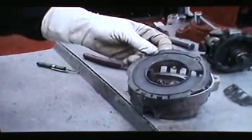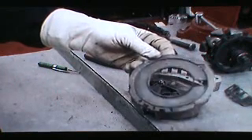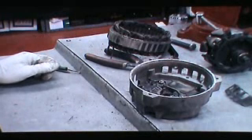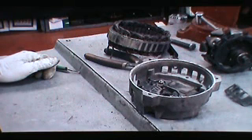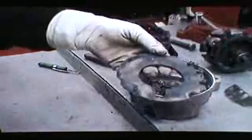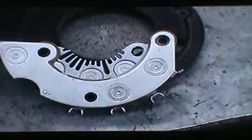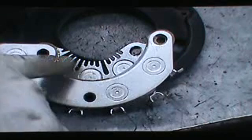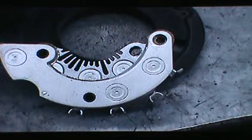The reason we're not reinstalling the baffle is that diodes have come a long way since this was originally designed. The avalanche diode, when it first came out in the late 80s, was a thin piece of wafer — very sensitive — and this baffle created additional airflow to help it last longer, though it didn't work very well. The rectifiers we have today are far more advanced in how the diodes are manufactured and the amount of heat they can withstand.